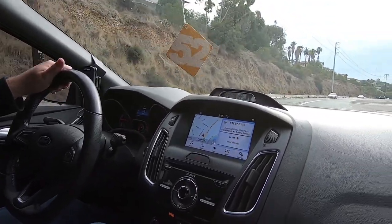We pretty much just let them coast. And that's how you bed in your brakes. In this part, you want to drive the car and let the air naturally cool them down. You don't want to just stop right away because they are hot right now. So if you have to do a couple laps around your block, a couple laps on the freeway, let them cool down. You want to be able to drive for a couple minutes to bring them down to temperature. So nothing crazy long, but I'd say like 5 minutes of constant rolling.